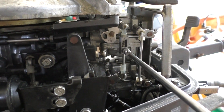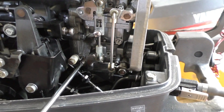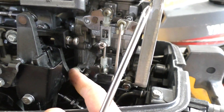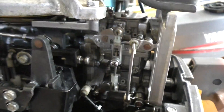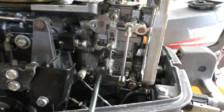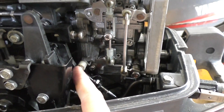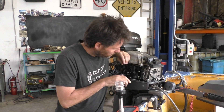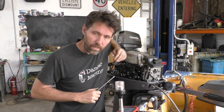I'm going to tighten this screw up now. Then I'm going to undo the screw for the little cam roller and gently press it against this throttle cam. With that screw undone the roller moves around, so I'm going to move the roller so it touches the cam while the throttle is all the way back at idle, then tighten that up as well. It came away a little bit as I tightened it so I'm going to use one hand to hold the roller against the cam while I tighten it.